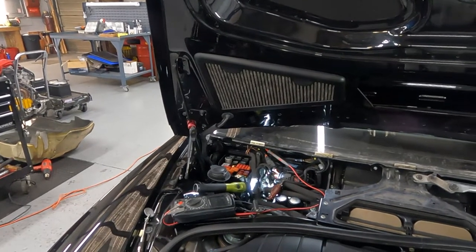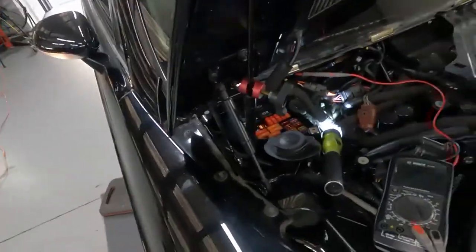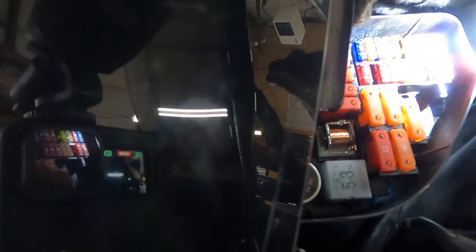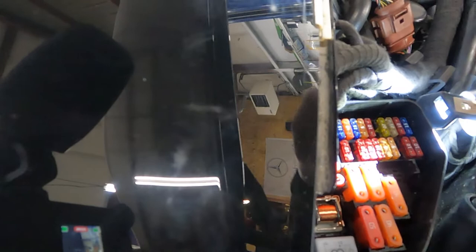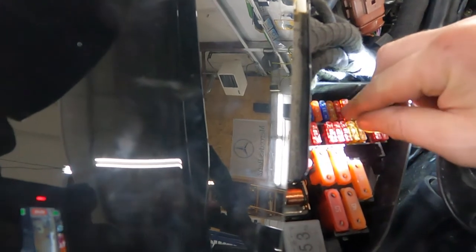Okay, let's try. Ilya, can you assist me, please? Fire up, just like we fired up without the fuse, and we can see the relay does not click. Nothing. Try a second time. Nothing. Okay. Now turn off the ignition. Off. We install the fuse, the wire we added to this relay. Ta-da. Okay, ignition on. Hop, click, fire up. Ta-da.